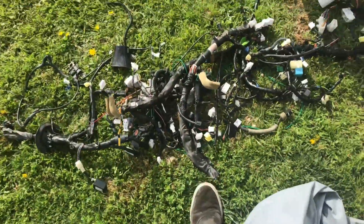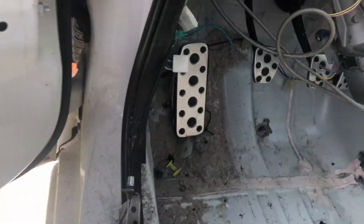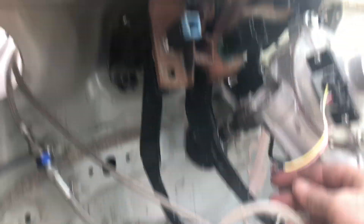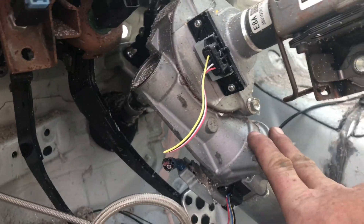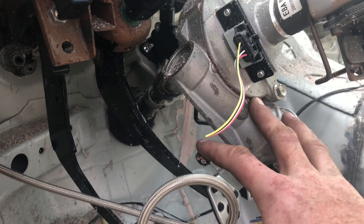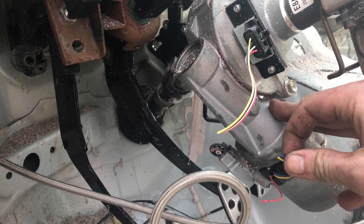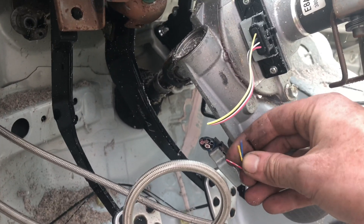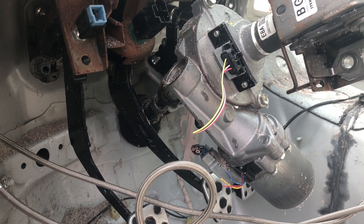The last of everything — some of the taillight stuff over here that I'm probably going to reuse. Then there's all the AC stuff and stuff under the dash for like the radio. Going after the power steering a little bit — when I cut it open, I saw that they have these pretty thick gauge wires in here, and then they have these little ones over here. So what I'm thinking is that this runs like a starter motor and there's a solenoid that turns it on and off. I'm guessing I could run power to ground with this and have it on, with the switch basically being two of these wires — I'm guessing it's the red and black one. I'm going to have to play with it a little bit, but I think I can get it to work.